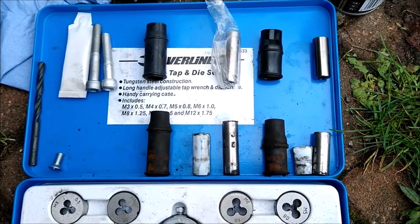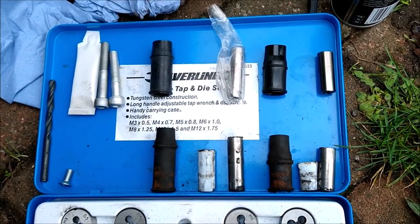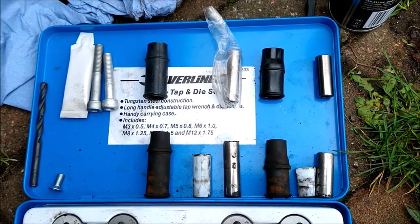So I'm going to reassemble them. These are a bit of a fight to get out - it's just a case of pulling and pushing from both ends. Just be careful that you don't kink the cable while you're doing that. So I'm going to clean up the holes where they came out of, grease them up and insert the rubbers.